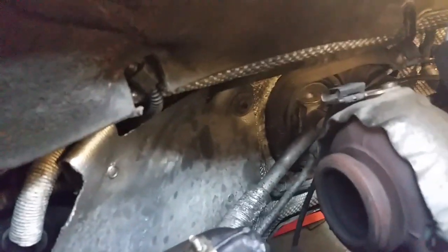Your DPF — you want to take the DPF off the turbo. It drops down and over the left there's a wee bracket in here which also stops it, and it's only a wee 13mm bolt that lets it drop down a bit further. If you take that off, I disconnected just one of the differential pressure pipes there, just to let it go down. There's a good bit of slack in those pipes though.